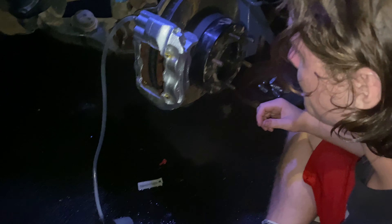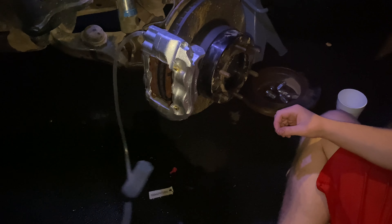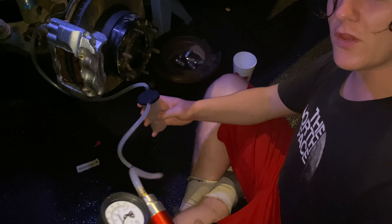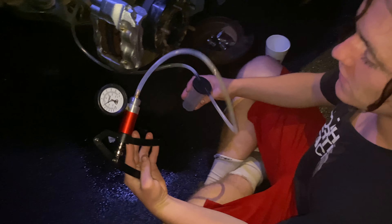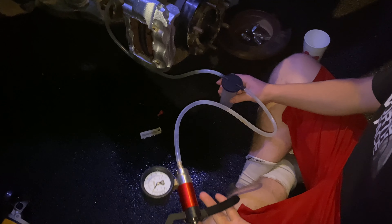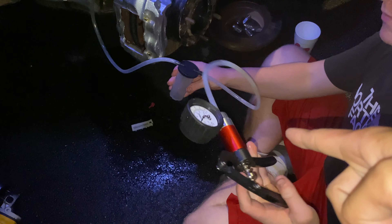Alright Sienna Racers, so today after we've got the TBU mostly installed, we got to bleed the brakes — you've got to do this when you put new calipers on. We got our vacuum bleeder here, a little catch can so we don't contaminate the environment with any DOT fluid. Because we don't want the fish to die.